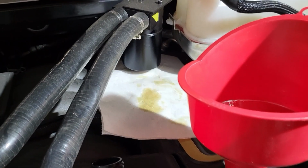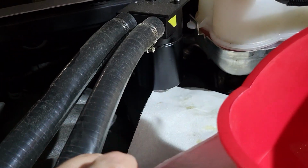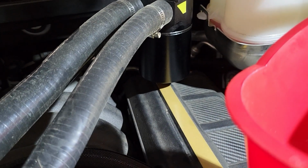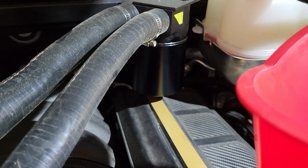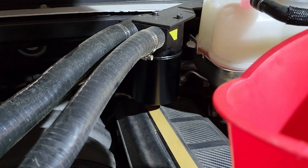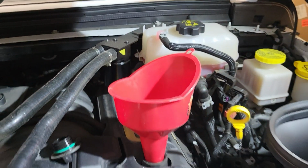All right, I've replaced the catch can. I lubricated the O-ring before I put it on, and I used this paper towel to wipe the underside to make sure both mating surfaces were clean. And that is a real nice reminder that after 5,000 miles, I'll pick up an ounce of nasty, dirty oil into the recycling that does not hit my valves. My valve seats and my guides, so my engine's going to be a lot cleaner from that.